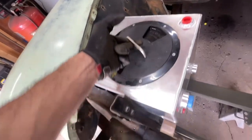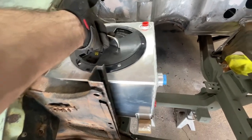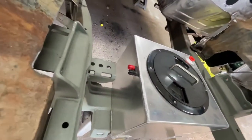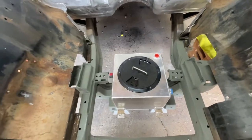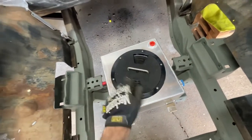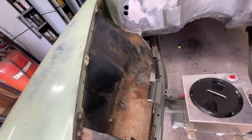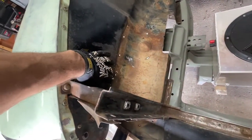Things I have to consider: I can't block the radiator because the fan basically goes in, so I need it to go in far enough that it's not blocking the radiator. I also can't go in too far where it may hit the tire - if it does hit the tire, I'll notch this out and weld some more aluminum in to make clearance. I also need to leave enough clearance to get the lid on and off - it just twists and pulls out of the way. I'm going to guesstimate my marks, cut it out, and that will also eliminate this rust. So yeah, let's cut it.